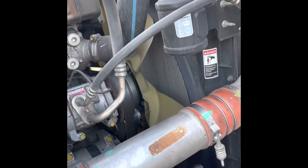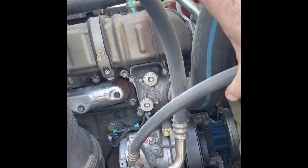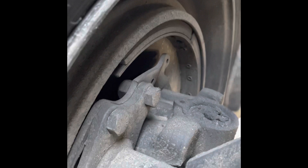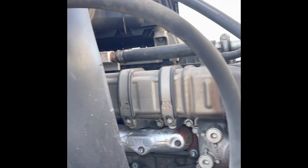Make sure that your fan will open up when you're in neutral — this is an automatic so it's a little different. Basically you're checking all your pipes and tubing, checking for any electrical lines, nothing broken loose or missing. You're going to be looking down your frame, looking at your leaves, making sure everything is connected, no rust or blue coloring on your brake pads, no leaks underneath the truck.